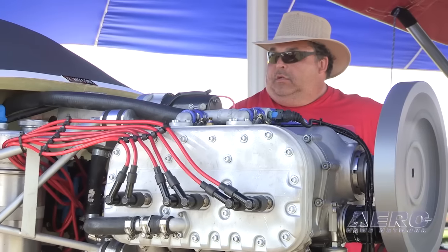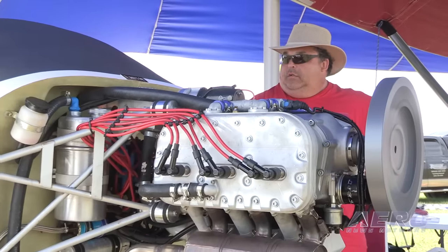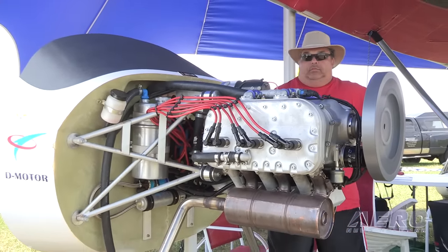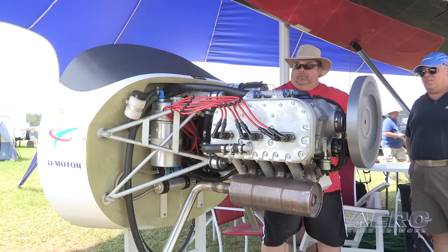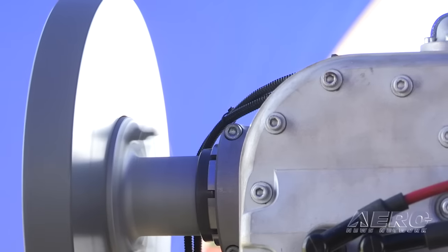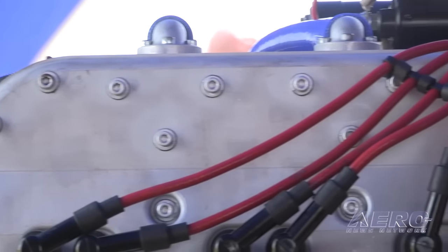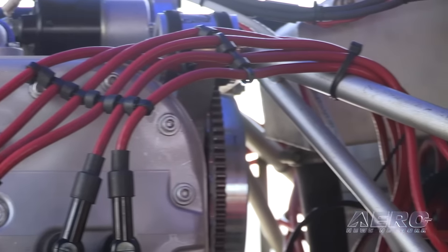It's very low moving parts. The four-cylinder only has 35 moving parts. The overhaul kit for the four-cylinder is $4,000. TBO at 2,000 hours, 3.2 gallons burn. It is as efficient an engine as you can get with all that simplicity, and yet now they've put the Nicosil cylinders on, fuel injection, and electronic ignition — all that to bring it into the 21st century.